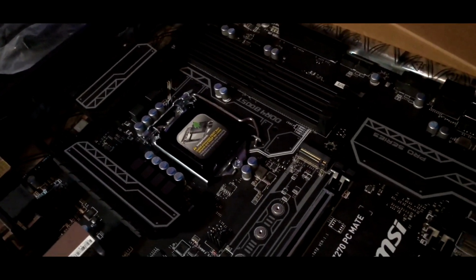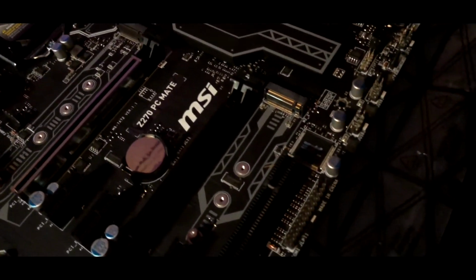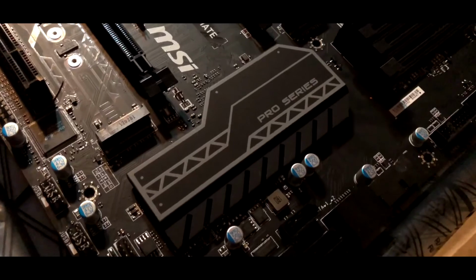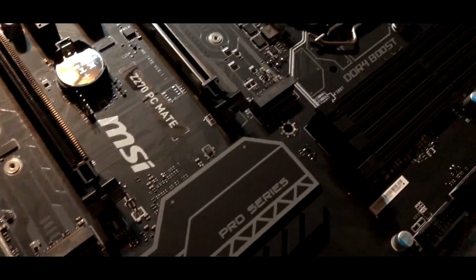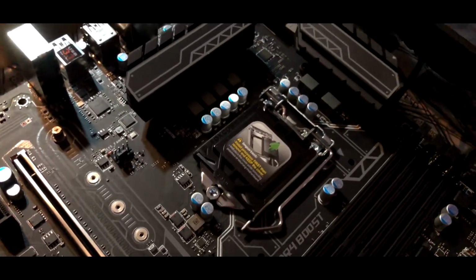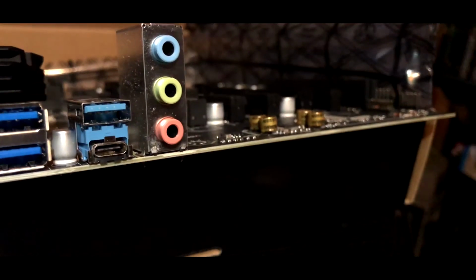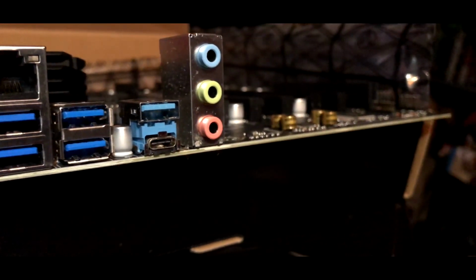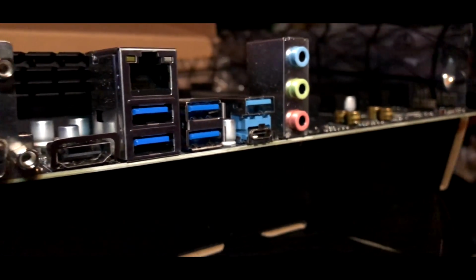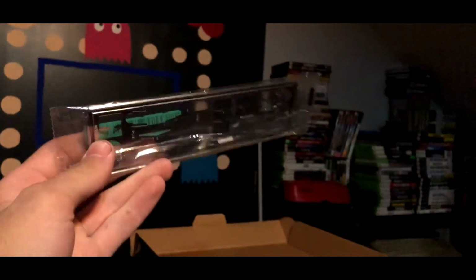The main frame of our rig here is the Z270 MSI Pro Series ATX motherboard that cost me $53 since it is refurbished. The Z270 here has 6 fan headers, so you can cool away with your PC as if it's an igloo. This offers even more with 2 M.2 ports for Optane memory or SSDs, 3 PCIe x1 slots, 2 PCIe x16 slots, 1 PCI slot, and 6 SATA connectors.